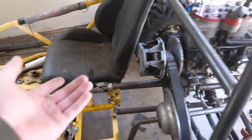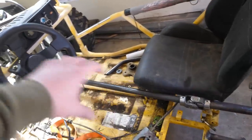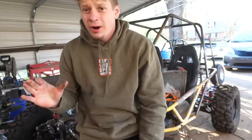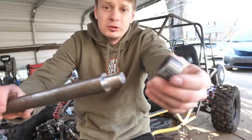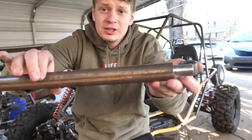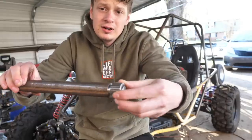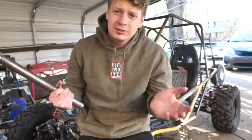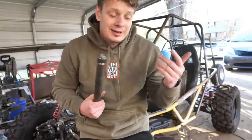I got my drive shaft. There's a U-joint in the middle because that part needs to be straight, and then the rest of the drive shaft can just go wherever it wants to. The drive shaft is going to be complicated because I don't really have a lathe — if I had a lathe it would be pretty easy — but I just had my local machine shop machine this keyed shaft down to accept this spline collar. It's just going to go on there and be welded. The welding rod I'm using has a tensile strength of 70,000 pounds, so it might break, it might not — I don't know.